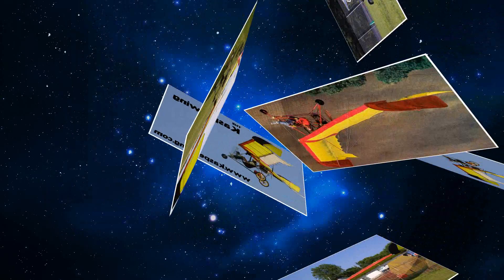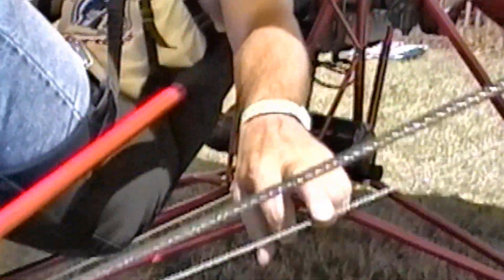This airplane looks a little better finished than the original ones. Have you done changes and modifications to it? Yes — a lot of things you can't see. I've gone to eighth-inch cables for the flying wires; they used to be 3/32nds. I did that because I did an engine mod and reinforced some of the tubing. So I've got about a 48-pound weight gain, and I'm going to go about 15 miles an hour faster. Because of the added drag pressures and weight, I've bumped up the flying wires.